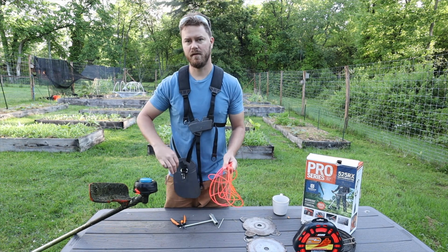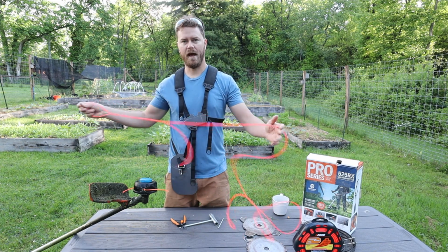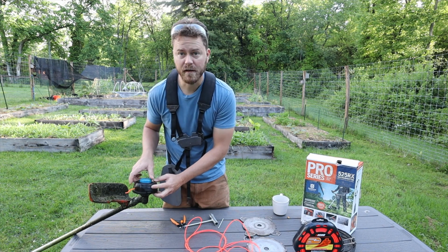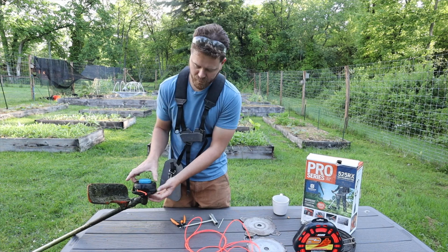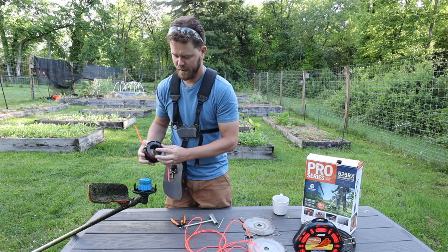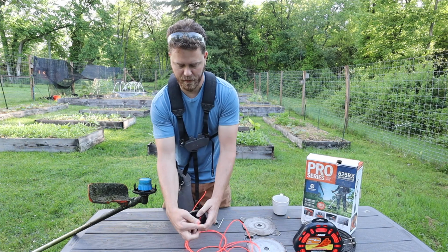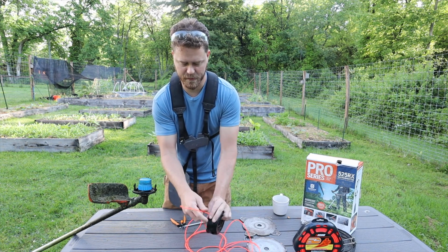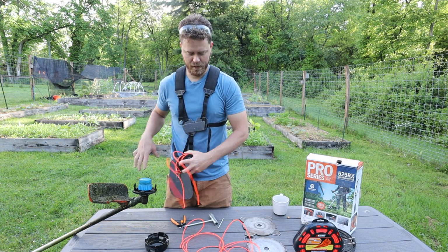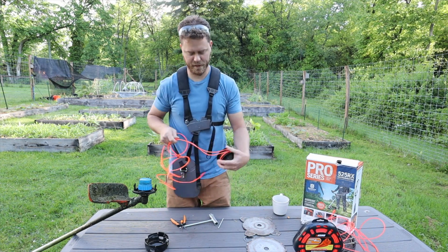For the head trimmer, before I show you how to replace that, I'll show you how to actually just add some new line and replace your existing trimmer. So on the sides, right here, and right here, on both sides, there are little push points. You just push those, top pops up, and then inside you have your spindle. So the spindle has the exit ports, which are going to have obviously the wire. I have a little bit of wire in here right now. I will take that out and actually reuse that instead of this new one, just to show you how to set it up.